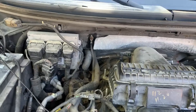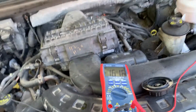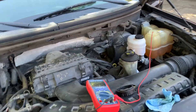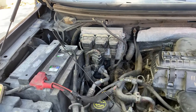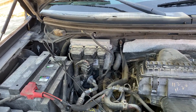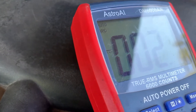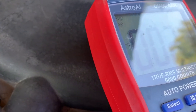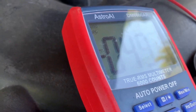After I got it all out and cleaned it up, look at what the voltage is — down to 160 millivolts, where it needed to be. This is why grounding points have to be checked and made sure they're okay. Make sure the grounding point to the battery negative is showing a low voltage. See, if I put it up there — that's perfectly grounded. That wasn't the case sometime back when the nut was not showing a voltage.